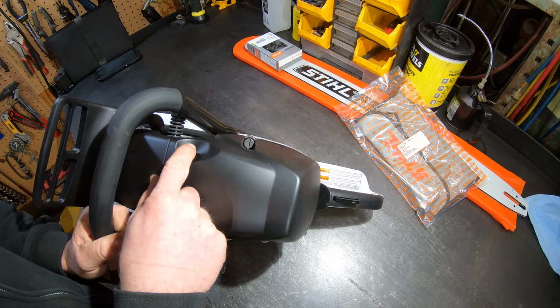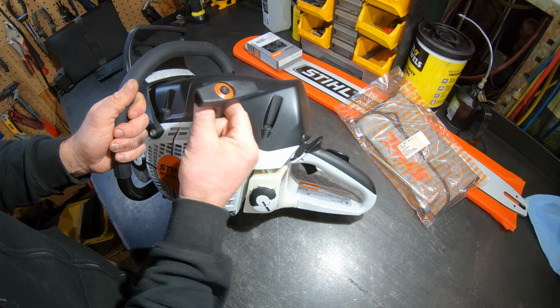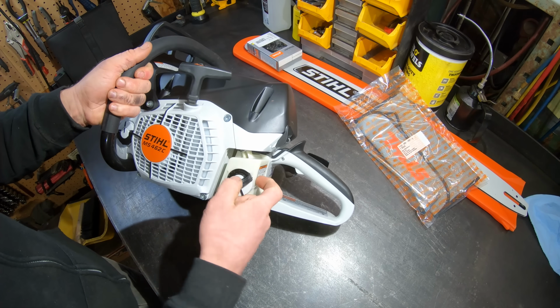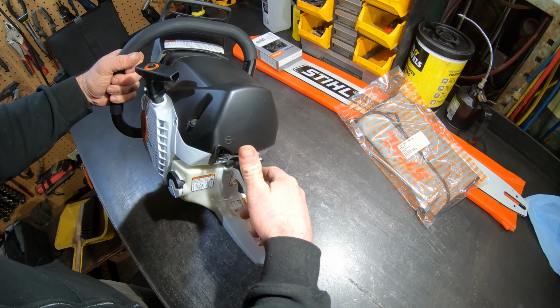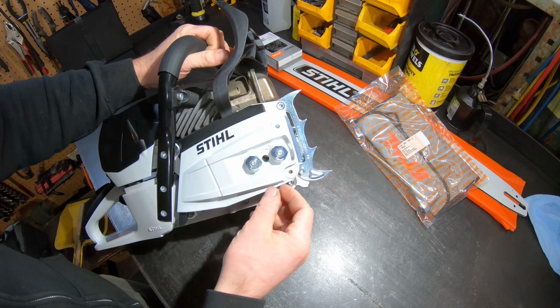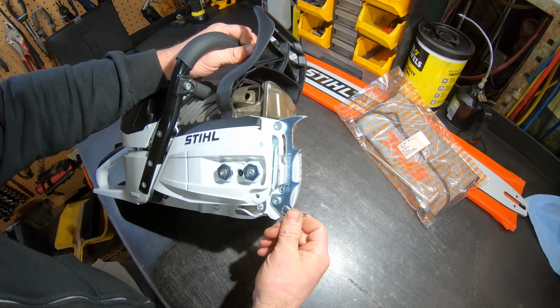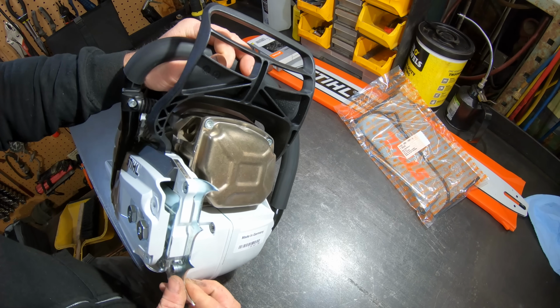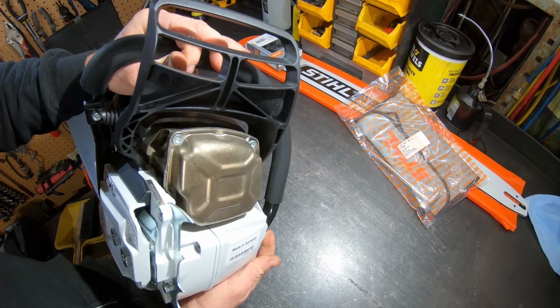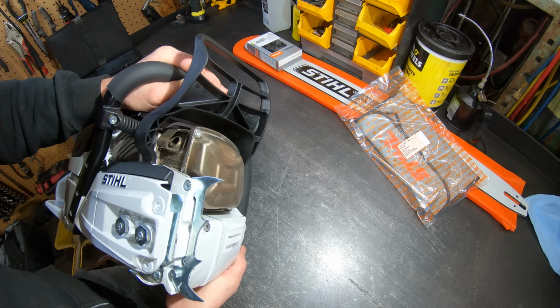Starting at the top, you do have a decompression valve here. These are the quarter turn screws that they have. Lasso start handle, ever popular flippy caps. M-tronic, so the 3-way switch, kill, run, start. So you do have captive nuts, incredibly anemic bucking spikes, their new style side cover. Surprisingly, the exhaust port looks decent sized. Sure, I'll be opening that up in the future anyway though, just because science.